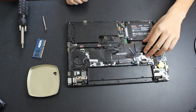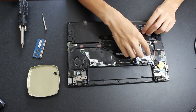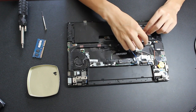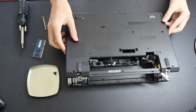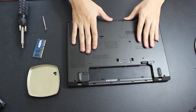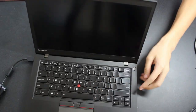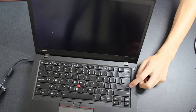You can also upgrade the Wi-Fi card, and you can add a wireless WAN card or a SATA M.2-2242 SSD into the larger card slot. You can upgrade and replace the screen, but that process is more complicated. To replace the bottom cover, push it back onto the chassis to clip it in, applying even pressure, then replace and retighten the screws. Plug in a charger, turn on the laptop, and if it posts and successfully enters the BIOS — congratulations, you are done!